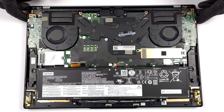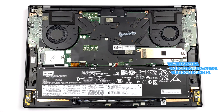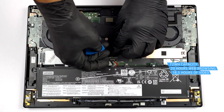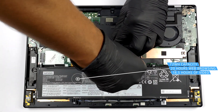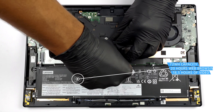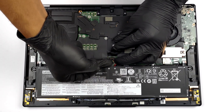The battery inside has a capacity of 72 Wh. It lasts for 20 hours of web browsing, or 18 hours and 30 minutes of video playback. To take it out, you should first unplug the connector from the motherboard, then undo all nine Phillips-head screws and lift it away from the chassis.